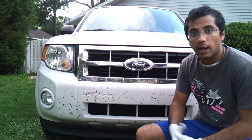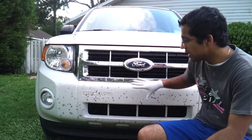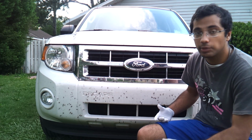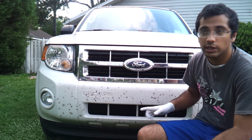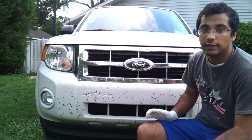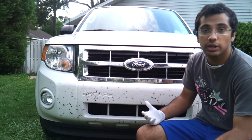So what I'm going to do is first blast it with water to try to take off as much bug guts as possible. After that, I'm going to use an all-purpose cleaner, Optimum Power Clean, at a 1-to-3 dilution. That's 1 part Optimum Power Clean to 3 parts water, essentially 1 ounce to 3 ounces of water.